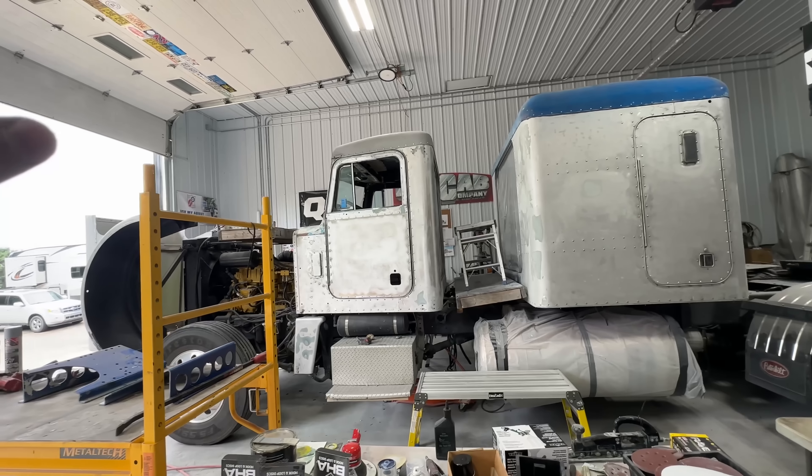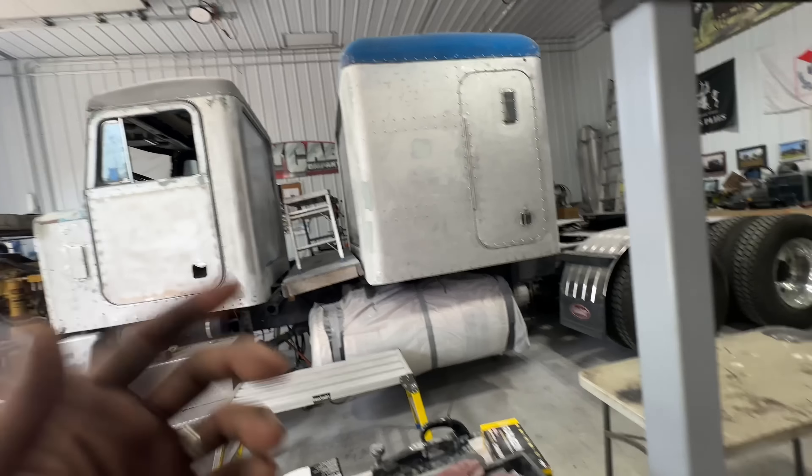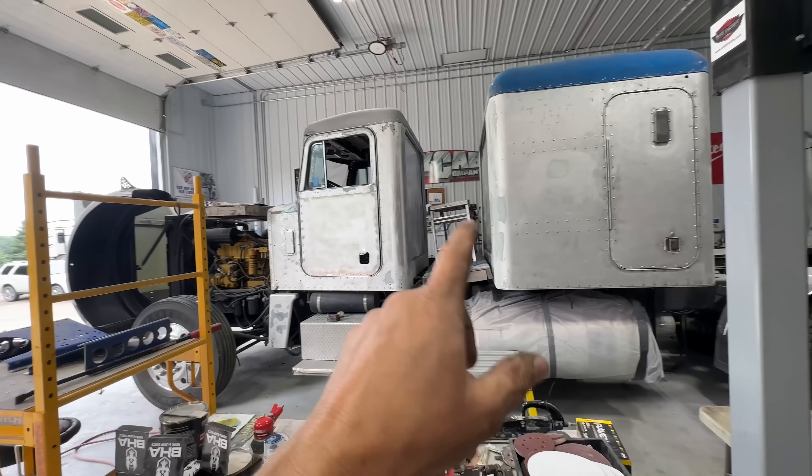So follow me on this. I'm going to put on the etching primer — I picked up a couple quarts — because when you go down to bare metal, especially aluminum, you want something that really adheres to the metal so the paint doesn't flake off. You see Chevy and Dodge trucks where big pieces of paint just fall off — that's because they didn't adequately prep the base primer. So I'll do a coat of etch primer on all the metal, and then two coats of high build 2K primer to fill in all the remaining scratches. I went and picked up another gun from Princess Auto — they were on sale.